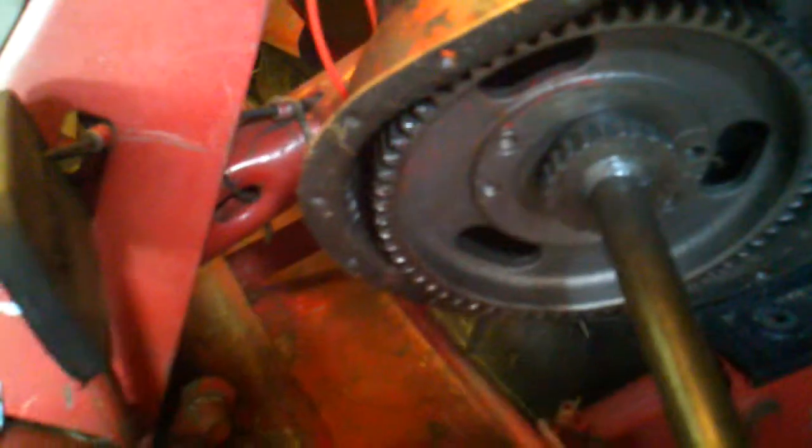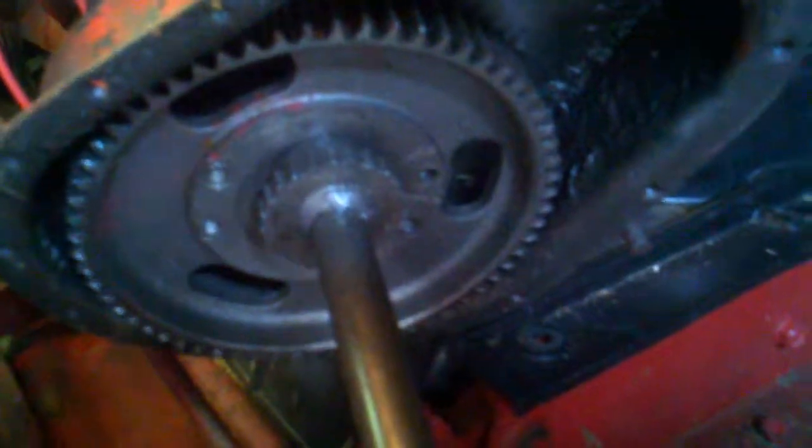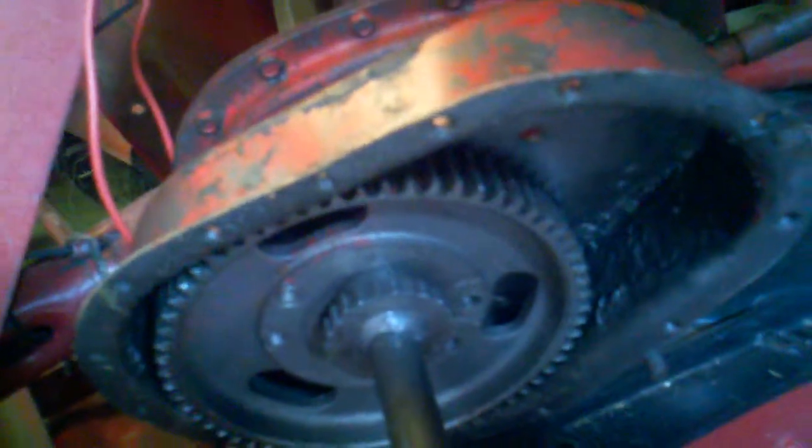There's actually four gears that hook on here where these holes are. They're only three quarters of an inch round, maybe an inch by an inch and a half. One of the gears, the tooth was actually missing off of it. So I'm thinking that whoever had it hit something with it or jerked it real hard and broke the little tooth off of it. Then it rolled around in there and just chewed it to pieces. It seems like they drove it for a while because the grease in there is just completely full of metal — it almost looks like an anti-seize type compound. It is just some nasty, nasty stuff, just full of metal filings.